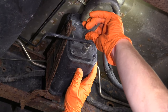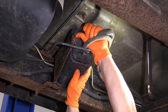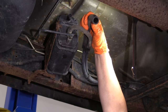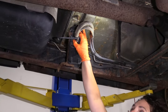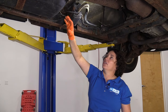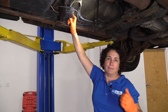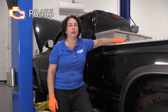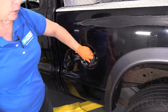You're going to check all the hoses. If you don't have a smoke machine, this would be the quickest test to do for a large evap leak. Another thing to check for: when you disconnect that hose right there, if you see gasoline coming out, that tells you the canister is soaked with fuel — it actually caused a vacuum and is taking fuel out of the gas tank. Then it's no good; the charcoal is filled up. Code P0455 is a large evap leak. The easiest place to check is always the gas cap.